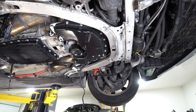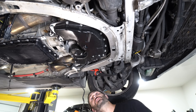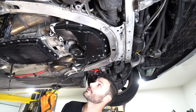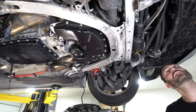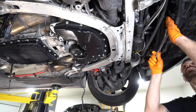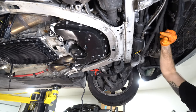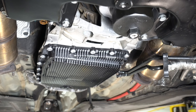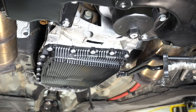All right, we're ready to put the torque converter bolts back on. I just need to line up the torque converter and the flex plate — got the socket on the front of the crankshaft. Now let's turn the motor over. There it is. Once we get all these snug, then we'll torque them down, and that is to 45 newton meters.